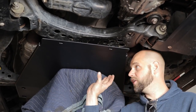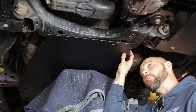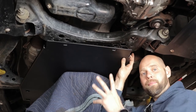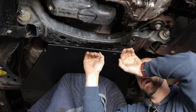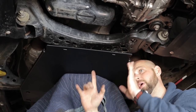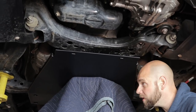If you're using a TRD front skid and you're going to use our transmission slash transfer case skid in the back, this is going to go up against the cross member, and then your skid is going to overlap it. If you already have that installed, you're going to have to loosen it up so you can get this between the cross member and your skid, then bolt it back up. I'm going to go ahead and let this jack down, grab the front skid, and we will get this put together.